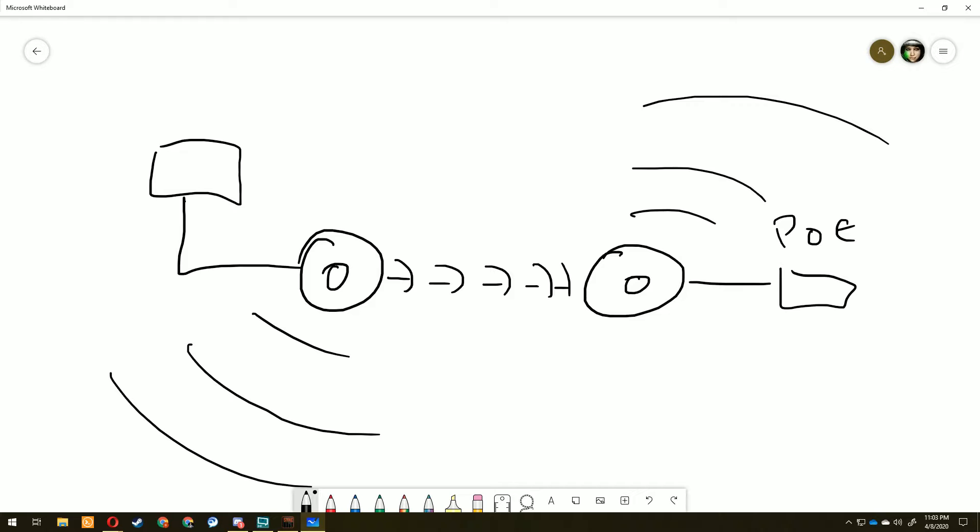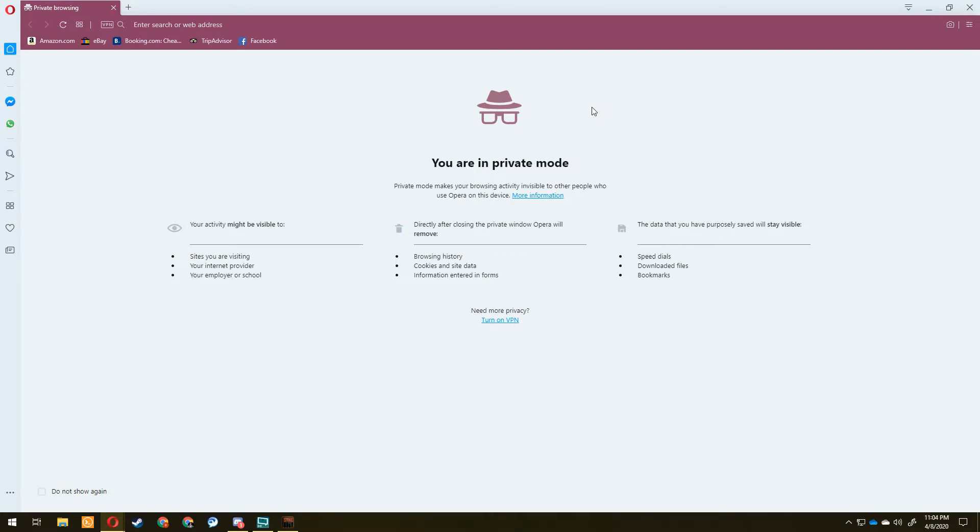This is kind of a last resort setting. Unifi will tell you not to use this wireless uplink feature unless there's no other option, because the performance is not great. If all you need is signal and you're not doing much — like watching Netflix or browsing — it's fine. But for gaming, wired is king. This wireless uplink will degrade the performance of both the downstream access point and the primary upstream one, since it's now using bandwidth to communicate downstream to another AP.